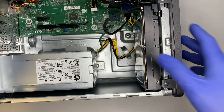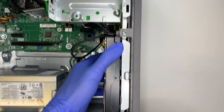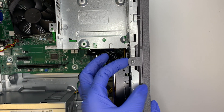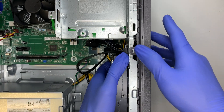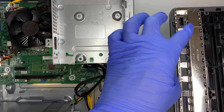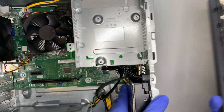Next, open the front panel. The front panel has three clips - bottom, middle, and very top. What you want to do is lift it up a little and push it to your right for each clip. Once all three clips are detached, the front panel comes right out. To put it back, align the USB ports and the bottom slide, then push it in and it clips back on.